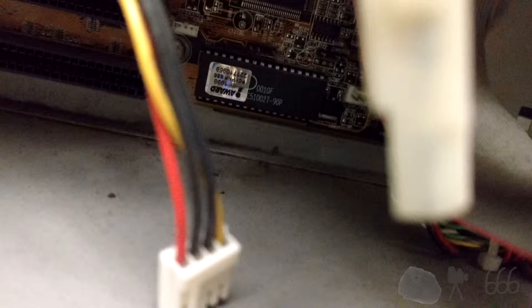In a departure from all the rest of the machines, we can see that this one makes use of an AWARD BIOS. Check that out — ribbon cable on the back. That is a SCSI ribbon cable. This motherboard has on-board — I believe they call that parallel 80-pin SCSI, but I'm not positive. It might only be 50 pins, to be honest with you. I've never actually counted. But it's there. Definitely an interesting thing to have on what is, otherwise, a fairly standard PC motherboard.